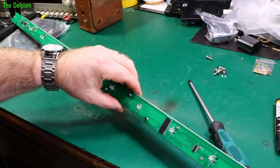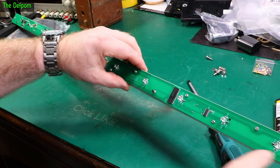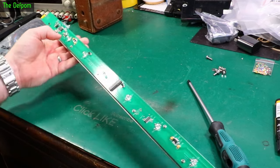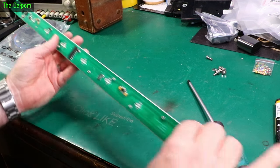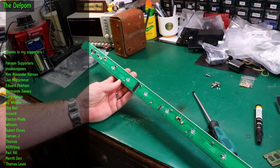I've just marked which LEDs are bad compared to the ones I found from the pole. It's the fourth one from the bottom — this one here, it's weak. And the first and second one down, here and here, they're also weak. So in this case that's D11, D12, and D62. Those are the ones I need to look at replacing.